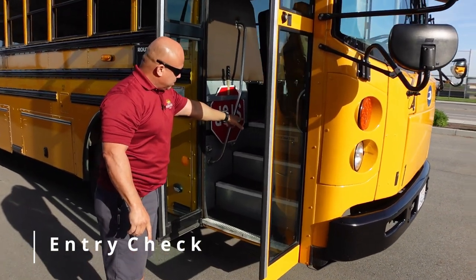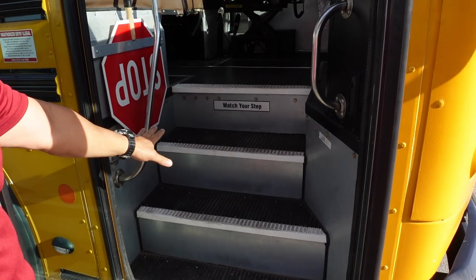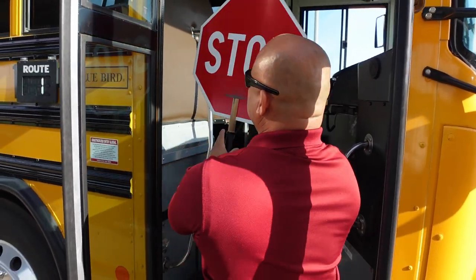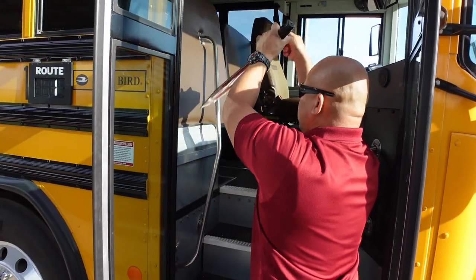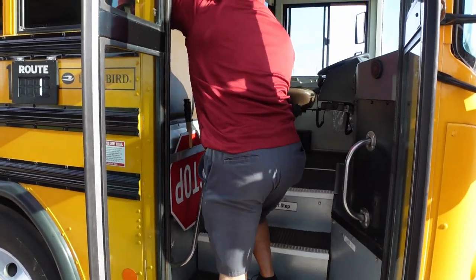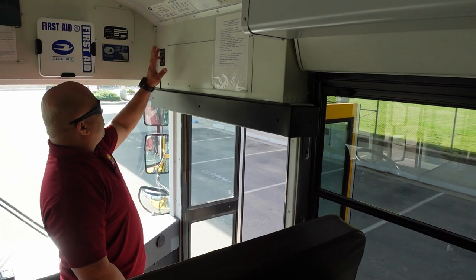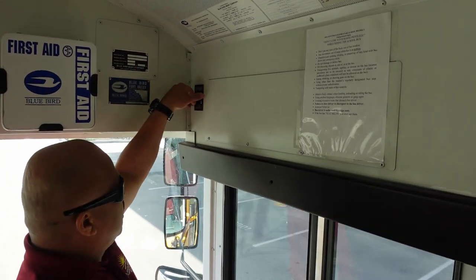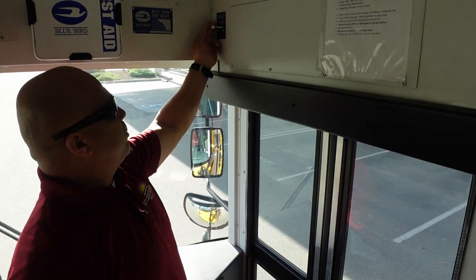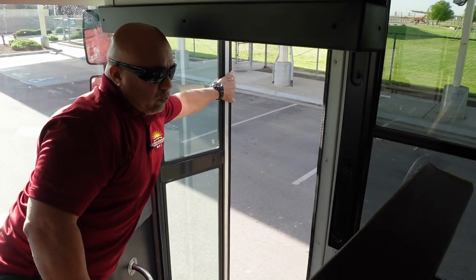On my steps, I'm going to make sure the step is labeled properly, there are no loose screws and no trip hazards. My handrails are secure. The stop sign is legible on both sides and there's no damage. Checking my modesty panel, making sure it's secure. My head bumper is secure. Also, I'm going to check my emergency release — this switch can be used in case of an emergency. I'll activate it to open and show the CHP officer that it is working properly.